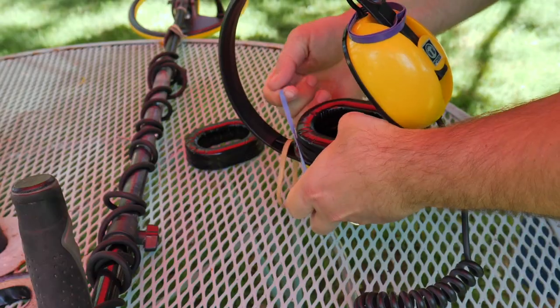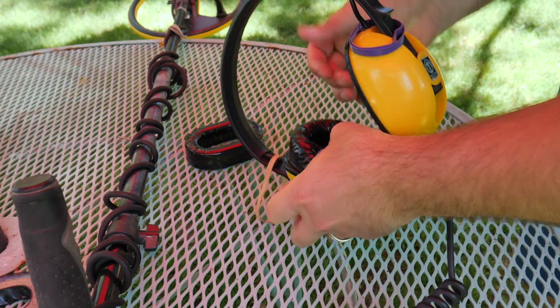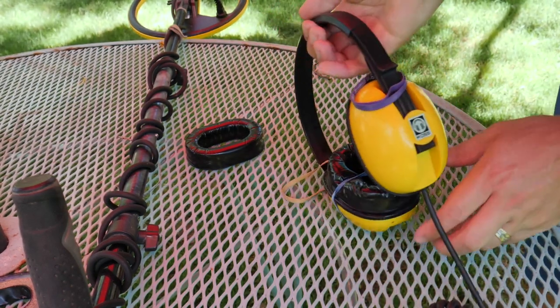The pressure of the headphones pressing against the ball should hopefully help bond those ear pads right in place. On mine it started to slip — I think because the ball was a little bit too big — so we went back to the drawing board and back to rubber bands. Instead of two, we just went with one right in the center, and we're gonna leave them sitting throughout the afternoon to cure, hopefully bonding really nicely with the AquaSeal.